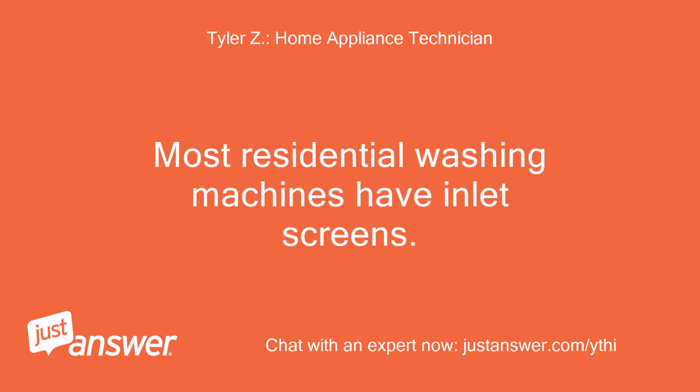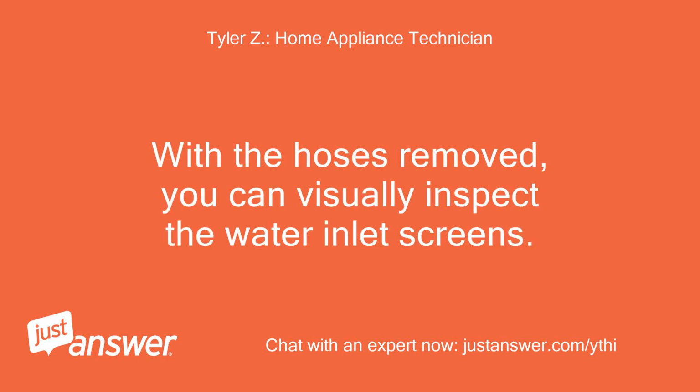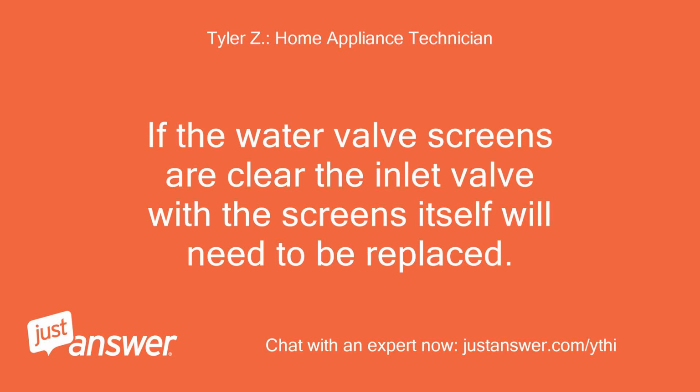Most residential washing machines have inlet screens. The screens prevent minerals from clogging the solenoid. With the hoses removed, you can visually inspect the water inlet screens. If the water valve screens are clear, the inlet valve with the screens itself will need to be replaced.